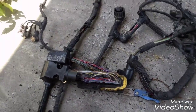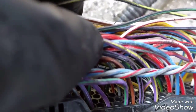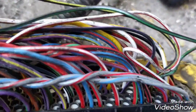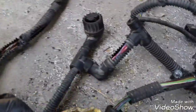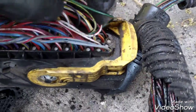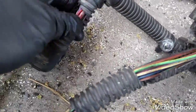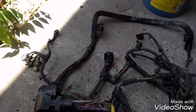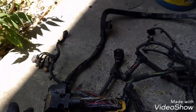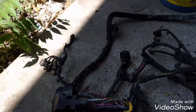I just wanted to show you how it looks from inside and how it gets damaged. You can see again here how damaged it is. This is from a 2011 truck — it's not even that old and it's already damaged, all the wires are bad. I replaced this harness because it was shutting down when the driver was on the highway running at 65 miles per hour.